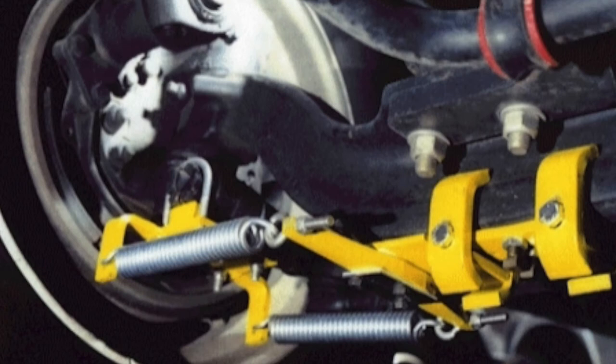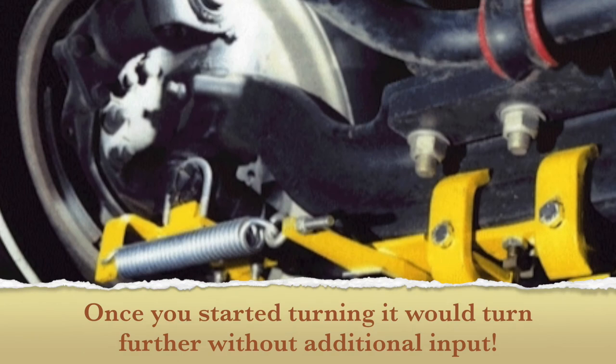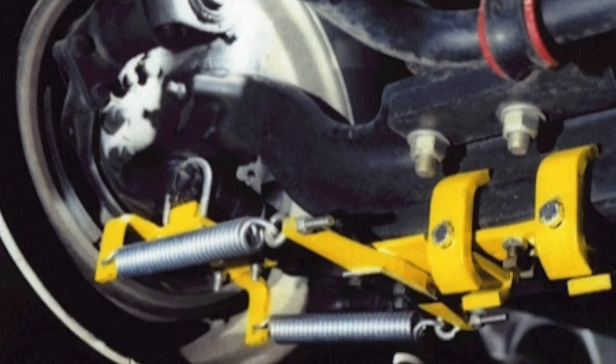That extra travel translated into loose steering and lack of feel. Removing the springs immediately, instantaneously cleared that up. Looking back, I drove 20,000 miles last year with that uncomfortable feeling unnecessarily. I actually looked forward to windy days because keeping tension on the steering wheel made it feel like I had more control. When it wasn't windy, it felt like the thing wanted to wander even though it really wasn't — I just couldn't feel where I was with that steering situation.